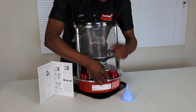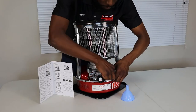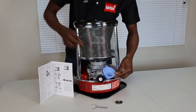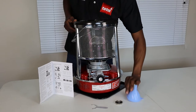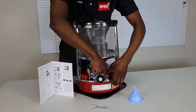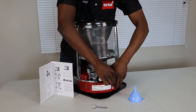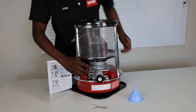So you're going to undo your knob — just put it in loosely so that we can go a bit quicker. Then from there you'll be pouring your paraffin into your funnel. Once done, don't put more than three liters in here — not more than three liters. Make sure it's always water-clear, clear paraffin. Then once you've secured your knob down and closed that in, it's time to ignite it.